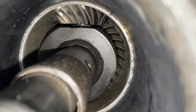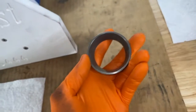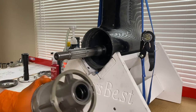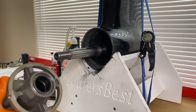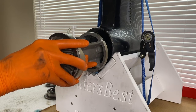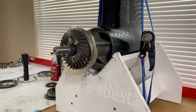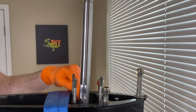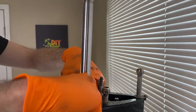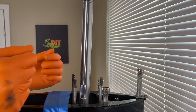Coming back inside for a close-up: the adapter tool is shifted all the way on and securing that nut, and the nut has screwed a few turns onto the lower thread of the shaft. This is the top bearing race or carrier that goes up top on the actual bearing. I've got the new bearing carrier, thrust ring, and reverse gear, and I'm going to lubricate the inner seals. We are going to install this bearing carrier backwards — it will help stabilize the propeller shaft as we tighten the pinion nut, and apply pressure to the tool to prevent it from shifting off that nut. It is in and flush with the tool. Back up top, inspect the bearing and shaft inside the cavity to make sure all looks good, then carefully shift the carrier over the shaft and align it over the bearing — it rests flush with the top portion of the bearing.